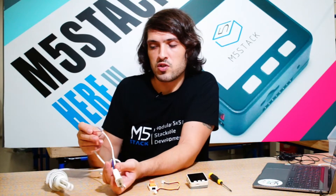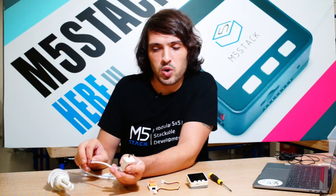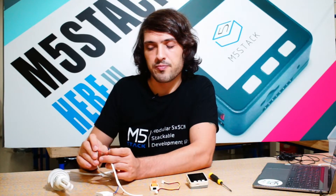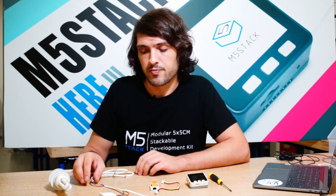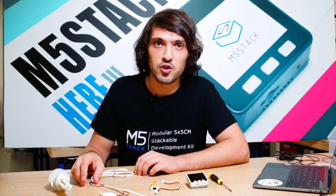All that we need to do with this light is to sever one of the wires. If you have a two-pin wire cable then this isn't a problem — you just have to choose the live or the neutral wire and sever one of them. If you have a three-pin plug then you'll have the ground wire that you do not want to cut. Remember we're dealing with AC electricity here, so make sure you know what you're doing first. We're not responsible for any electrocution that you might cause yourself if you don't know what you're doing.